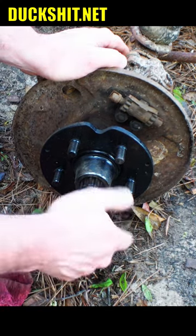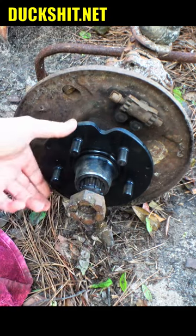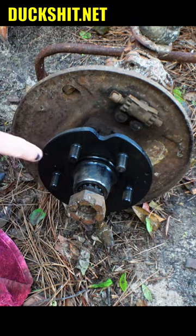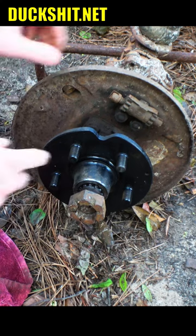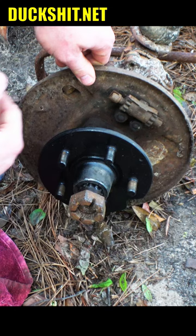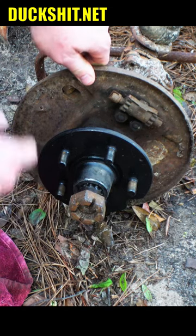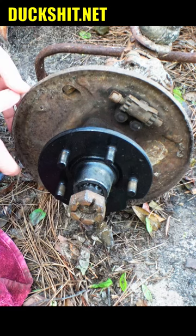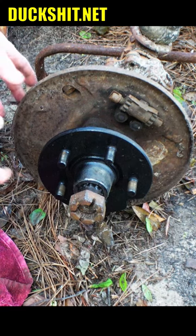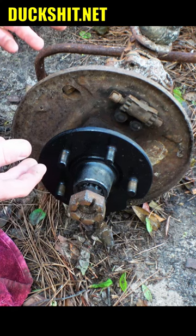I think I can put the nut on the end, and it will need a spacer, but that's nothing I can't turn down on my lathe. This is good to know — I can actually use a hub from a bay window bus, and I can drill these out to different lug patterns also. In 5x130, the Porsche lug pattern would make it really easy to put a set of Porsche rear brakes on here, and I can make a custom bracket for holding them. Not hard stuff — in fact, there may even be something available that I can just purchase.